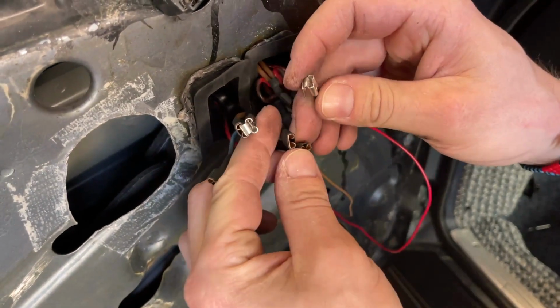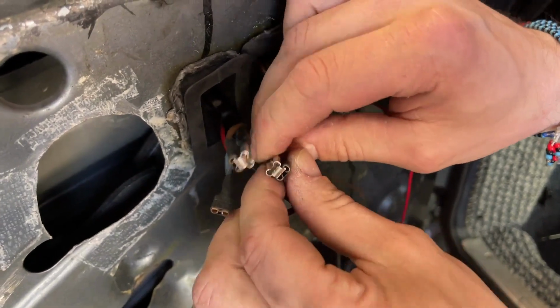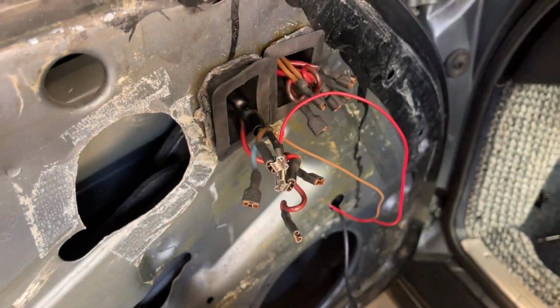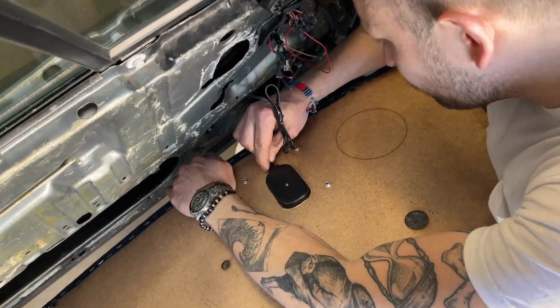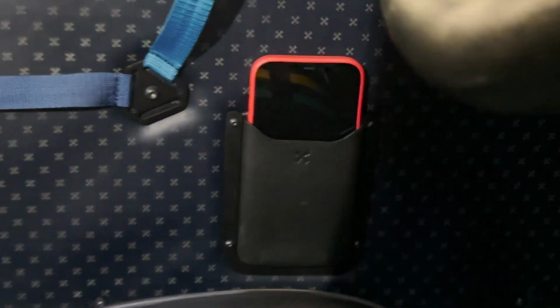Connect the connectors to the power window switch. Red is plus, brown is for ground. If you're not sure how to connect the converter, ask us. Connect the pocket, connect the battery. Make sure windows work properly and the wireless charger charges the phone.